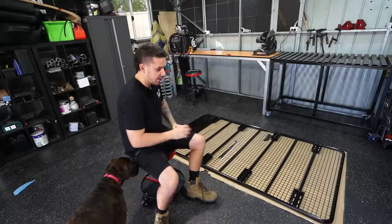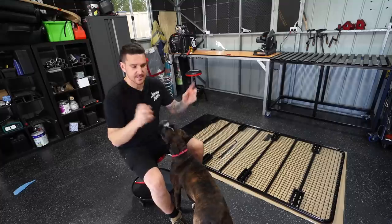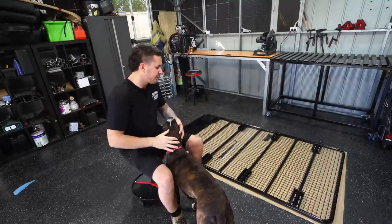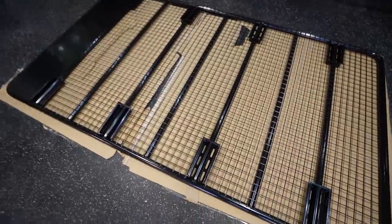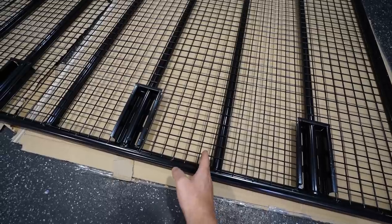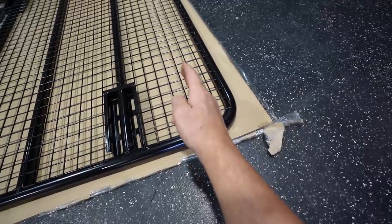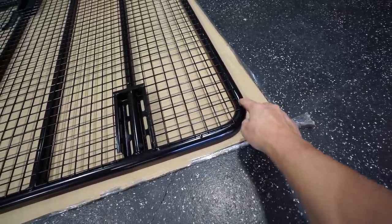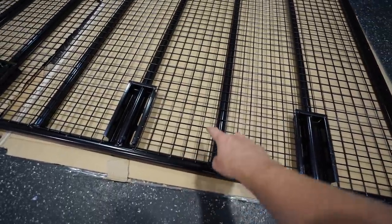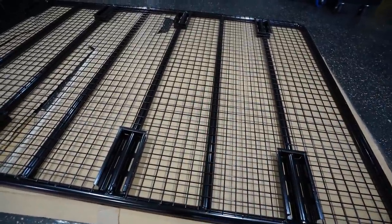This thing is only $400 for the whole thing, and it should be pretty easy to adapt it to our Triton. It isn't technically made for our Triton, but it does fit a Pajero and I'm pretty sure they've got the same roof. So what I'm thinking is I'll take a measurement of the Triton, figure out exactly where we need to cut it, cut right through the roof rack, come down to the back, cut this section off here so we can keep our 90 degree bend, and weld it back on to recreate the back end of the roof rack - just moving it up a little bit.